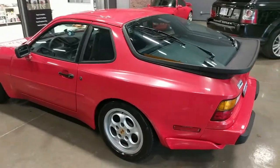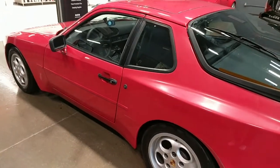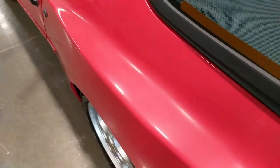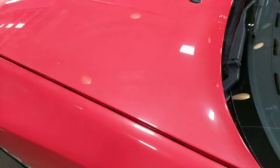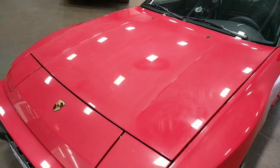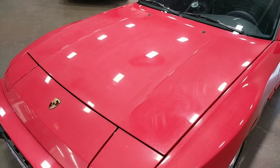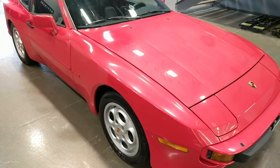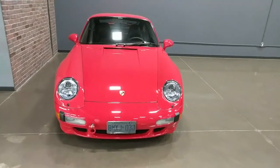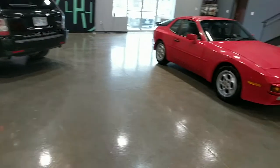The car is now out on the main shop floor and the wash process is complete. As it's dry you can see the oxidation is still obvious — very chalky on the surface with that pink look, surface marks, and almost a pattern of water drying on it. That's our goal to remove. We'll do paint depth measurements first, then likely start with a compounding step to remove the bulk of the oxidation, then move into finish polishing to bring back depth of shine and make it look more like the 993. Just being clean, it already looks a lot better.